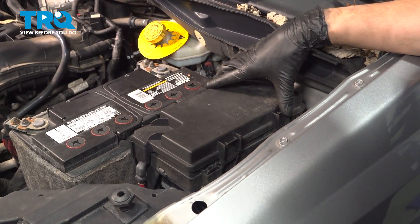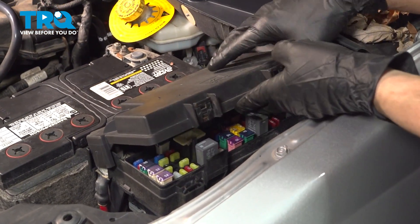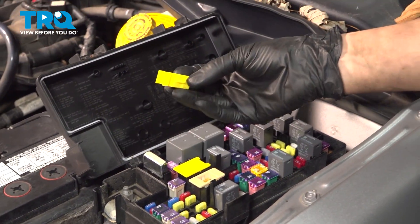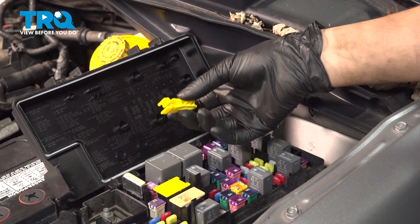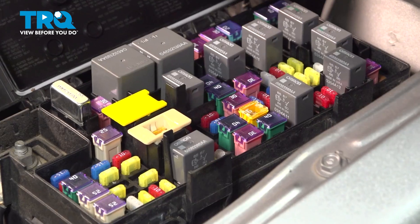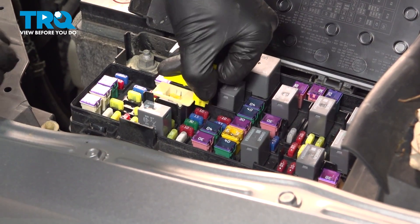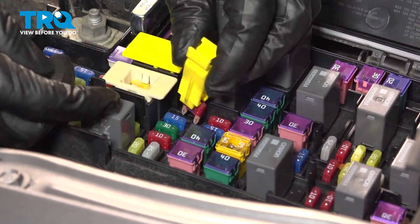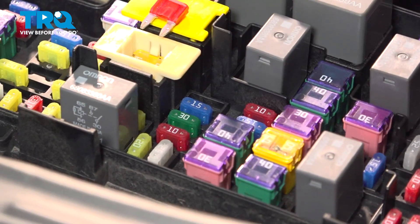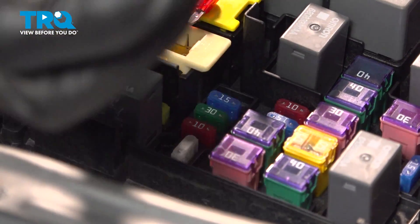Before we start, I want to release fuel pressure from the system, so I'm going to pop this fuse box out. It's located on the driver's side under the hood, right next to your battery. Open this up. You'll find your fuse puller right here, this yellow piece. If you don't have it because it's missing, just use some needle-nose pliers. I'm going to pull two different fuses that have to do with the fuel system — a 10 amp fuse and a 20 amp fuse. This one's a little bit stuck, so I'll just grab it with my needle-nose.